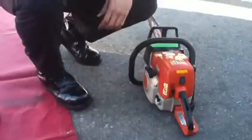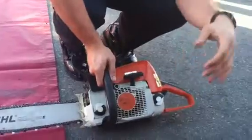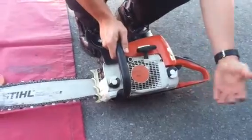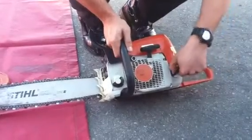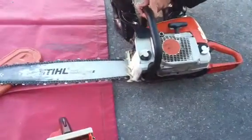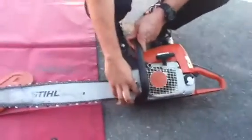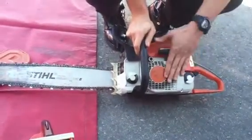This takes 50 to 1 — 50 parts gasoline and one part oil. The STIHL 310 holds 18.9 ounces of fuel. You can identify the fuel tank by the gas tank icon. Simply twist the black cap, turn it, and it comes out. The chain oiler holds 11.2 ounces of STIHL bar oil. In the event that you do not have any STIHL bar oil, you simply use 30 weight oil — however, after use the saw is cleared out of service. Right here is your starter grip, flywheel, and flywheel cover. You may also hear the term starter handle — make sure you know both.